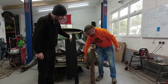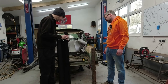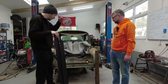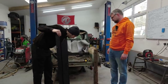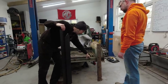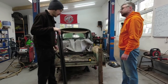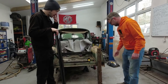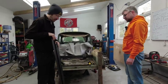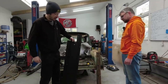The repair panel goes all the way up into the boot floors, but the best approach is to cut out just the piece you need. It goes all the way up to the fuel tank essentially and has a spare wheel hole. You'd end up cutting out the bumper reinforcement plates which aren't on the repair panel and would need to be made separately - but the car is solid there anyway, it's just the bottom edge that's caught it. Thankfully this repair panel is available, otherwise you'd be spending a long time making it up. Repair panels save time and are quite reasonable.